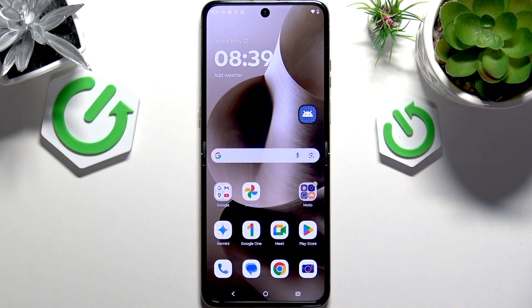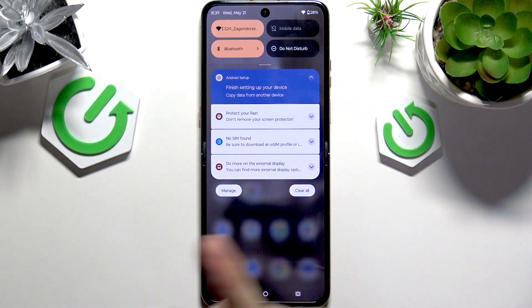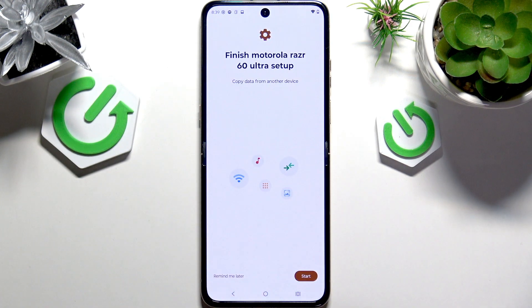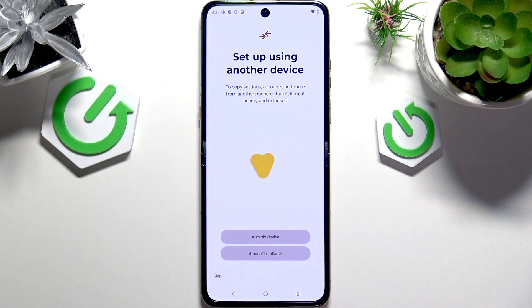Let's go to the next step — slide down from the top of your screen and you'll see the notification: Finish Setting Up Your Device. Click on Continue Setup Wizard, then Start. You'll be asked if you want to set up using another device. If you want to copy settings, accounts, apps, photos, and data from your previous device, do it now, because later that option may be unavailable. The native option to copy your apps and data from a previous device is only available once you're asked about it — if you skip it, it becomes unavailable. You can use a third-party app, but the native method does the most. Feel free to select which type of device you have and follow the on-screen instructions.